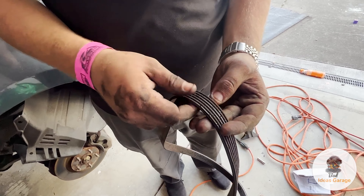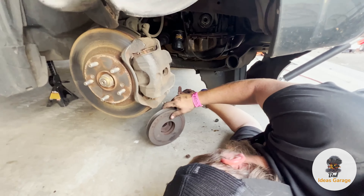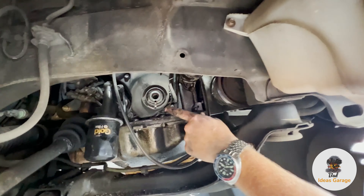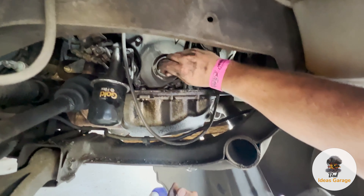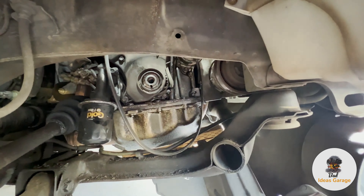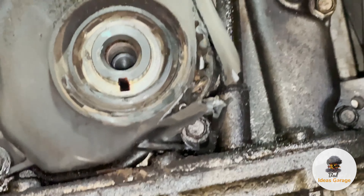We took the power steering out — power steering's out up here. Next we're going to pop the serpentine belt off and balancer off, see how that looks. That one looks like it's out 180 — it definitely is. So that could be interesting. It really depends on where the crank is relatively. I can see a triangle. Where's the mark on the balancer though? Sometimes they're weird ones. Brand new, never used. Alright, so there's a tensioner for the serpentine belt — got that up. This should just pop right off. Get wiggle with it. There we go, my life is balanced.